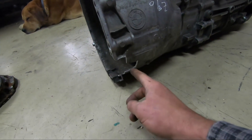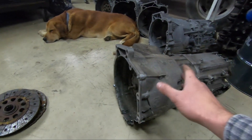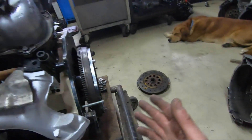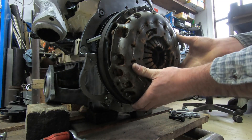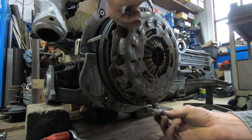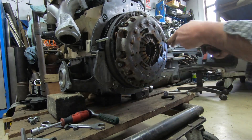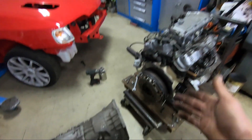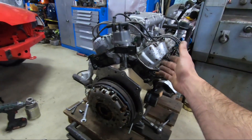On the six-speed you have to cut a little bit more than on the five-speed, but for demonstration purposes we can bolt this thing together. Now we can install the friction plate and the pressure plate — we're using all stock BMW parts. And that's it, now we can mount the BMW gearbox onto the Ford engine.